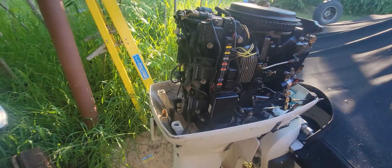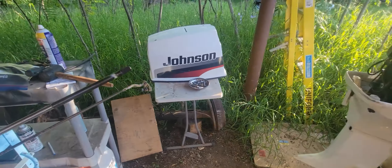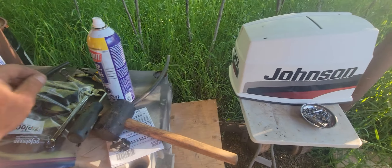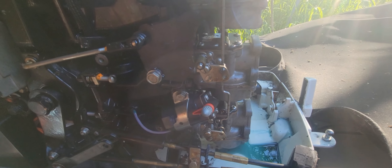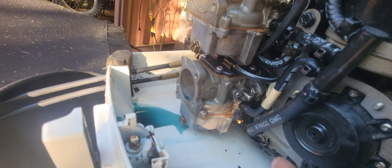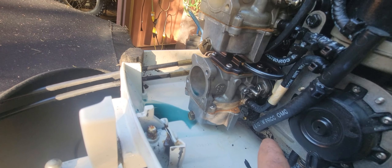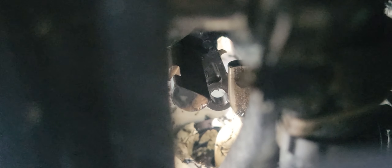This is the three cylinder 1998 50 horse Johnson — I think they're the same for different models. It's actually seven sixteenths. You loosen that thing and you're gonna have to work way underneath the carburetor. The best way to get it is from the port side, finicking around between the carburetor and the fuel pump.